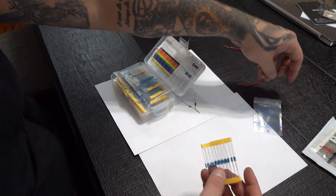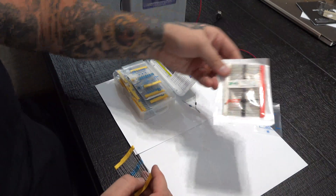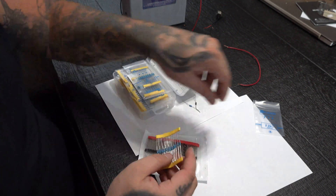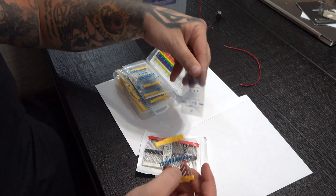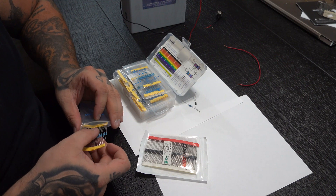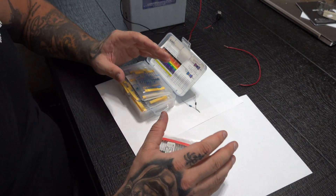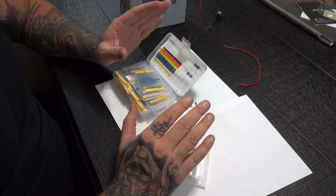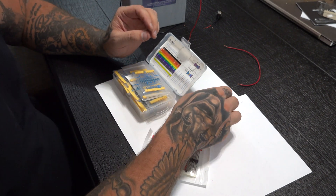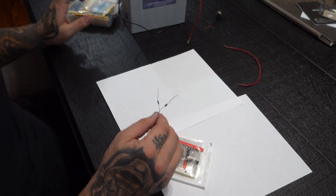This is cheap — all this was like 15 bucks for I don't know how many resistors of all different kinds, and this one was like $3 for a bunch of rectifier diodes. They're IN4004. For this one I used a 2.2K ohm resistor. The reason I used that resistor is because of how bright the light was before — it was very bright — so I brought it down a good bit so there was a very clear difference between using it as a running light versus whenever it was flashing on and off or braking. That's as easy as it is. It's very, very simple.